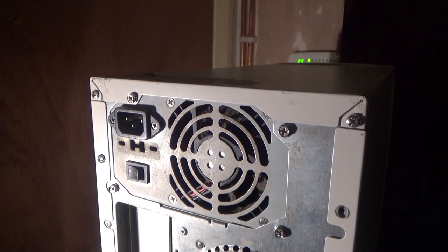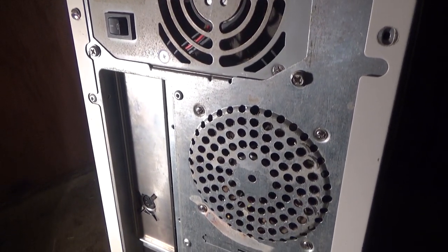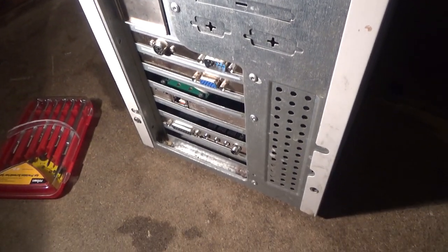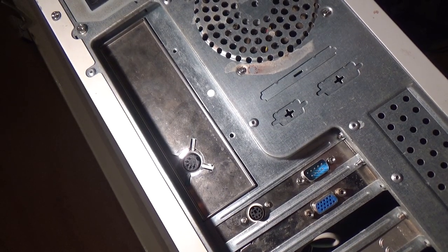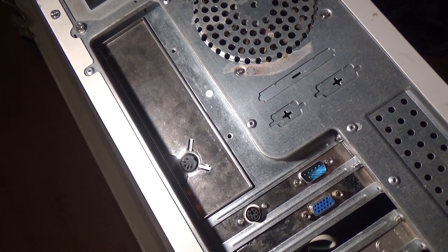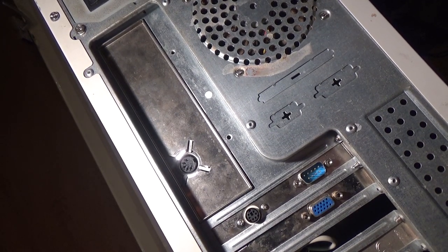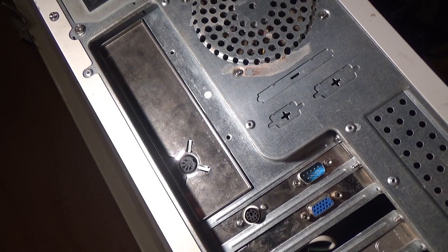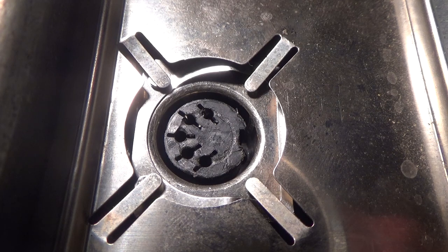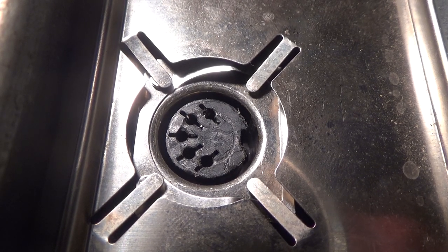At the back of the chassis, it becomes clear that this is an ATX case with an AT backplane shield. This wasn't actually so uncommon at the time, as AT cases were going out of production. It was often more cost-effective to make just one case in the ATX form factor, which took advantage of mounting holes sharing the same spot, and then just offer a shield to adapt it. You could even sell this backplane IO shield separately if you wanted to be a dick about it, and I'm pretty certain some manufacturers did.